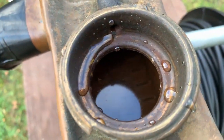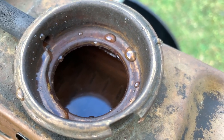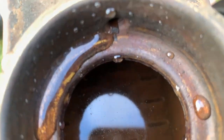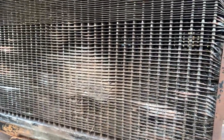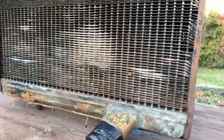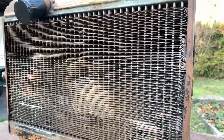You can see how it looks inside — still a bit filthy and dirty, but we'll wash this radiator a couple of times and it's gonna be fine. You can see these little pipes running vertically through the radiator, and the horizontal elements are just there to increase the surface area so you can eject more heat. It looks like our radiator is fine, so we can now concentrate on building a new adapter pipe and put it back into the car.